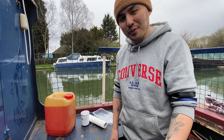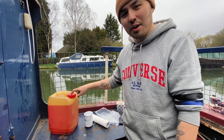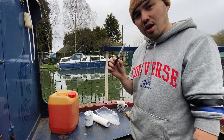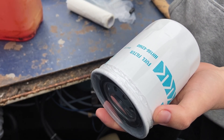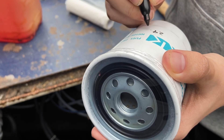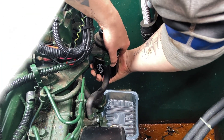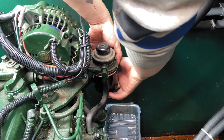So the next stage is the fuel filter, and for this you'll need your new fuel filter, a little bit of diesel, some kitchen towel, some gloves preferably, a little drip tray to catch any runoff, and a sharpie. I'm just going to use my sharpie to write down the current date so that we can quickly look at it and see when I last changed it. Get your drip tray ready before you start trying to unscrew, and keep in mind that these filters can be really hard to get off. You can use a belt wrench and they also make special adapters for sockets too.